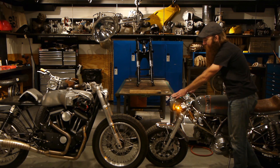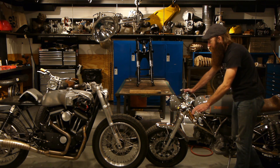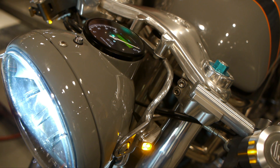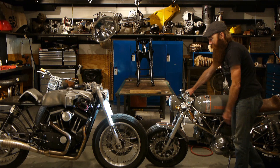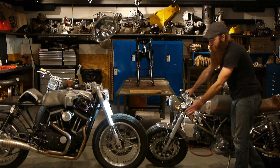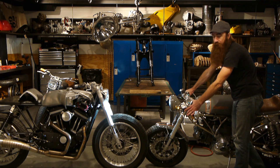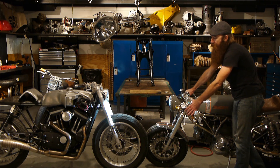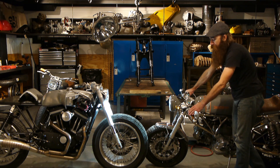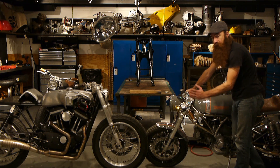You notice when the bike comes on the headlight stays out — that's part of the headlight cutout relay. Now if I start the bike, as soon as it starts the headlight comes on. It's helpful to do it that way so you can turn your bike on without draining the battery, leaving all the power available for the starter to actually start the bike. The headlight cutout relay also works with a single push-button switch, so if I wanted to just tap to flash a quick flash of the high beam when passing a car I can do that. If I want to switch to the high beam, press and hold a little bit longer, and if for any reason I need to turn the light off, press and hold and it turns off.